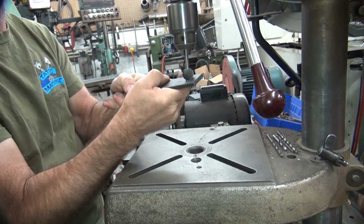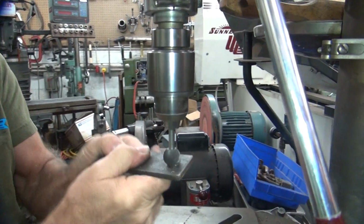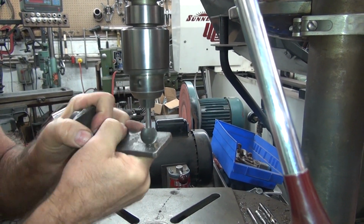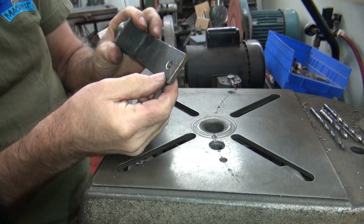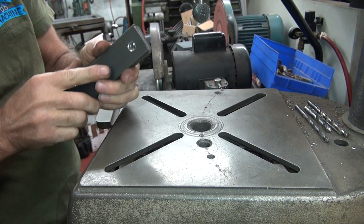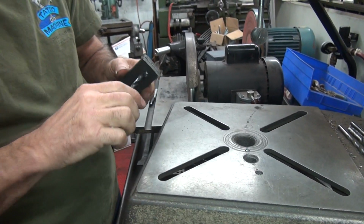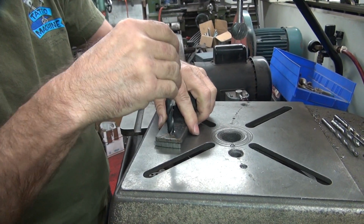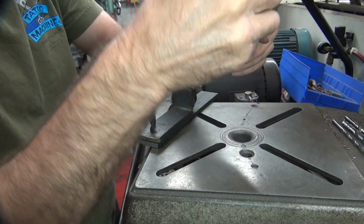Fancy, huh? Oh, we should all have one of those. It's a burr for doing grinding. It's the best deburring tool out there. It's a nice, good radius finish, way better than a countersink. You still got to cut that one, right? Cut what? Cut that into a smaller bracket. Problem with that is it leaves a burr on the inside of the hole.